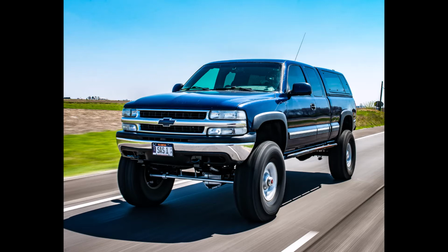What gears do you have in your rear ends? I got 456s, so I built the truck originally for 38s. I didn't think I was going to go to 40s, so 456 made sense. Yeah, I know, I was stupid. I was young and dumb. I mean, in reality, I built the Cherokee for 40s, but I didn't think I was going to go to 42s. Right. And by the time you buy 43s, and then 47s. And then why stop there? Next thing you know, you run ag tires. Yeah, I certainly didn't build the truck for 42s, which it may or may not get in the future. Yeah. I got to rework the whole front suspension, I think, to make 42s fit, so we'll see.